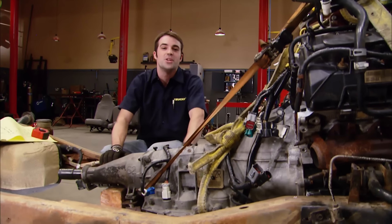Welcome back to the shop. We've had a chance to install our shortened temporary drive shaft — that should be more than enough to get us through stage one of this build. When we go to stage two with a manual transmission, we'll go with a brand new drive shaft. If you need to get a job like this done at home and you don't have the tools or experience to lay down a decent and safe weld, you can take a measurement, send your drive shaft off to a drive shaft shop, and they can shorten and fully balance it for you for not too much money. Now that we've got our engine and transmission locked into place, we're going to roll the chassis back under the cab one more time, set the cab down, and see how much clearance we gained with our new firewall relief.